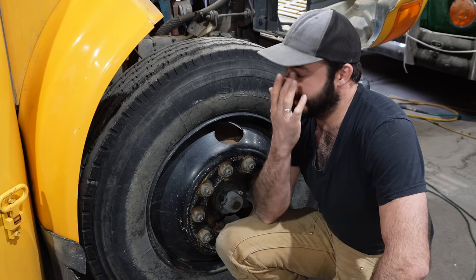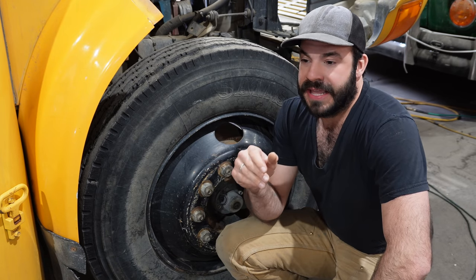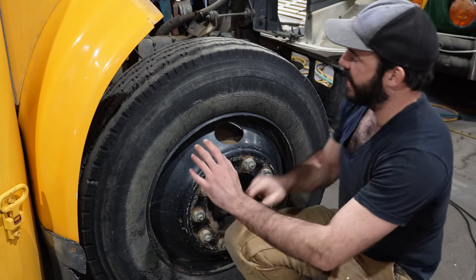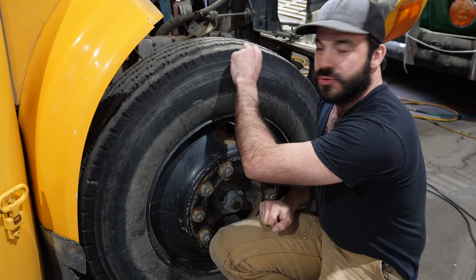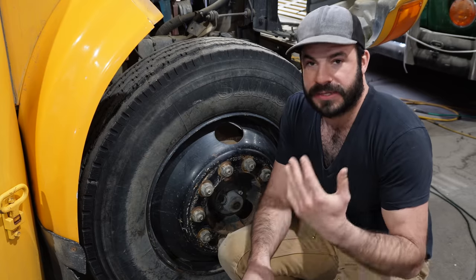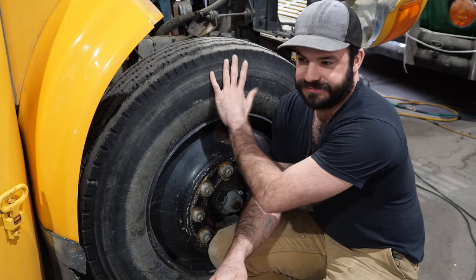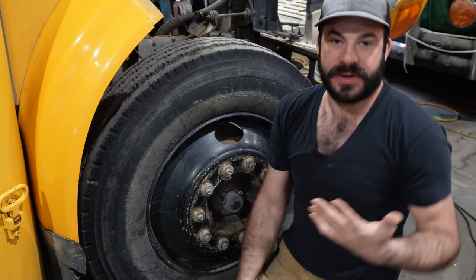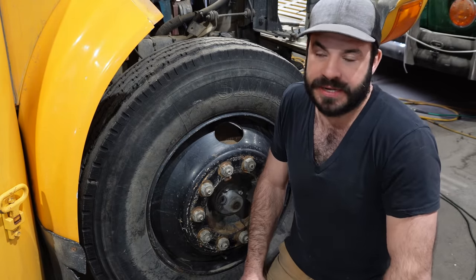You can get used tires, and that's often not a bad way to go. And you can also get what are called recap tires. Recap tires are where they actually take the shell, the casing of the tire, and fit new tread to it. Now, you can't install those on the front for safety and a whole lot of other reasons, but you can put those on the back, and that's where 4 of your 6 tires are. So it's not a bad place to save money.